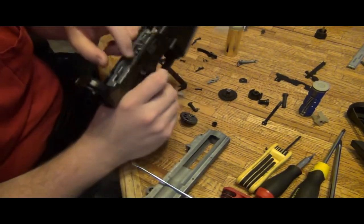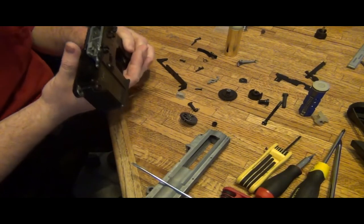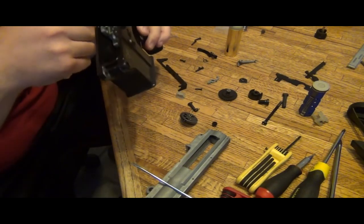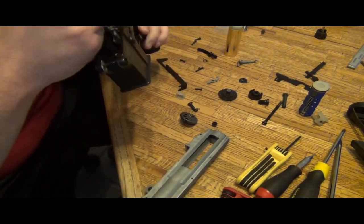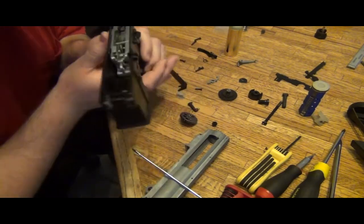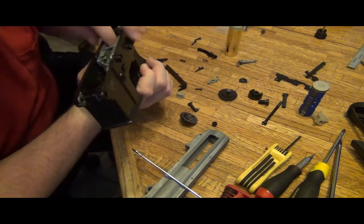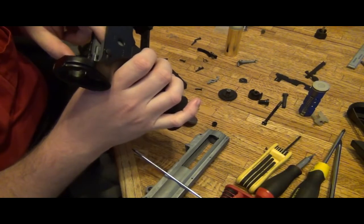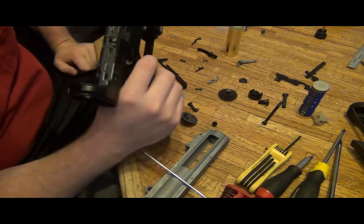The reason you have a lot of this play is the brand, probably. There's not going to be very much shimming that I can move from the bottom to the top. Huh, that's interesting. Maybe it's just me. Let me see something here. Yeah, it's the spacing. There is some space in the bottom of the bevel, which means that it's because of the way I'm holding it, isn't it? Yep, that's interesting. As I rotated it, the bevel fell back down. There is some space, but I can't put another 0.1 millimeter because it would make it too tight.